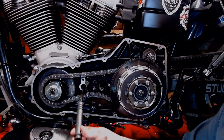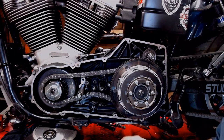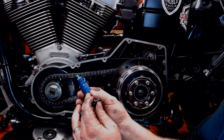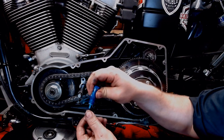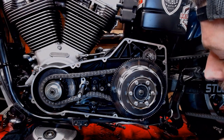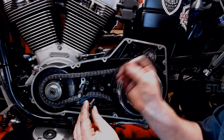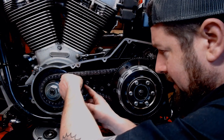So got a lot of nice good grease here on the shifter shaft. We're going to slide this in over top, in through the hole there. Now we're going to take our bolt here. We've got a little bit of blue Loctite — I think this is Permatex, whatever, one brand is as good as another. We've got some medium strength thread locker here. We're going to just put ever so slightly a little drip in there. A lot of stuff you don't actually need Loctite on on a Harley, despite popular belief — you just put it down to proper torque specifications — but this, since there's a lot of leverage on it and you stomp on it with your foot, we're going to put a little dab of thread locker on there. A little bit goes a long ways. No reason to get carried away with this stuff.